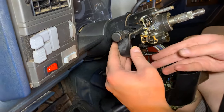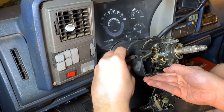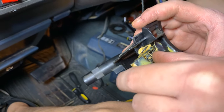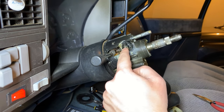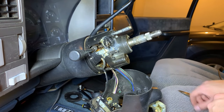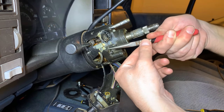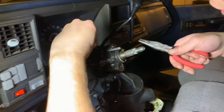There is this piece in the lever — we can go ahead and unscrew our tilt steering lever and pull this piece off. Right there is that high and low beam piece that you don't want to lose. This is the pin that locks your steering wheel when your key is off. We've got a spring here that we need to remove — it's held in with a quarter inch screw at the bottom. We can loosen that and work our spring out from underneath it.